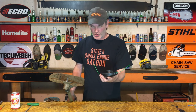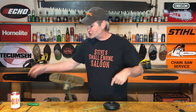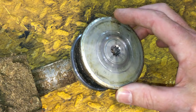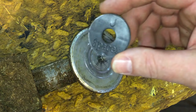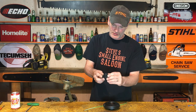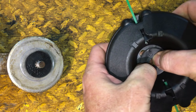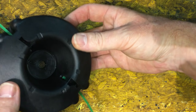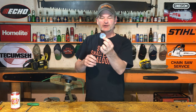This line head that he wanted put on there will go on this straight shaft right here. Just in case you're interested, here's how you do it. Make sure that little washer thing right there is on there, and then your J-spacer goes on there. Take that triangle - it's a 10 millimeter triangle-kind-of-shape thing - it goes in from the inside of that line head. You pop that in until it's seated down like that, then that goes on next, and then there's a big washer that goes on there too.